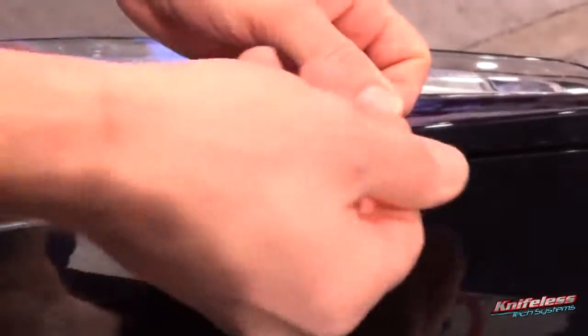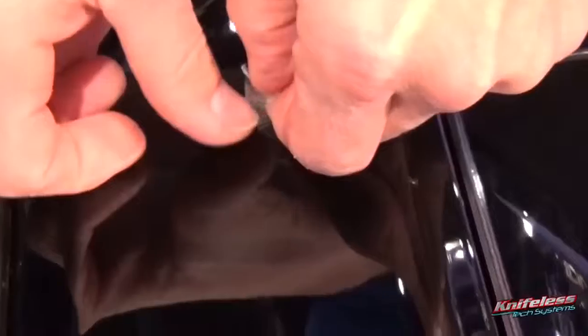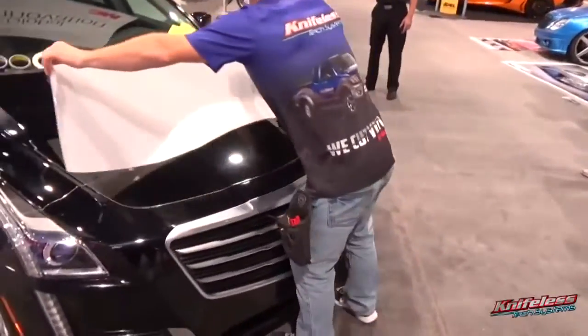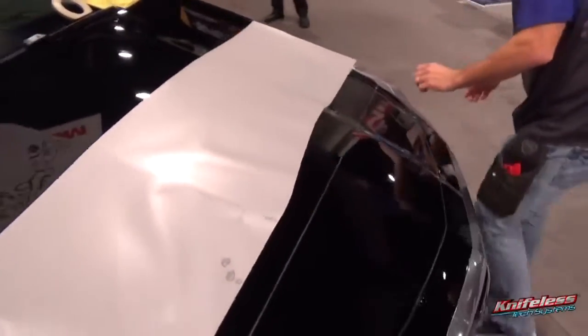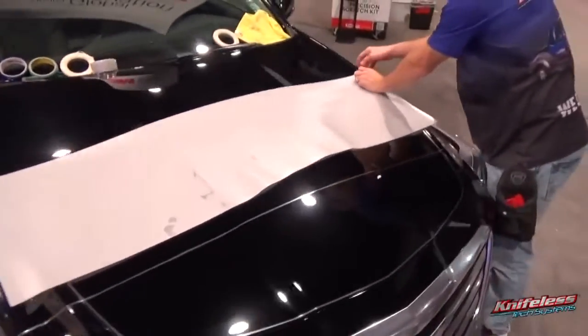So you just want to release the wire and keep the tape on, and then just hold it onto the surface. Notice how he's keeping the tape on and locks it in position there. This had 4 edges. You want to make sure you release all 4 edges and then tack it on. Once that is good to go, and you know you can pull the wire easily and safely on all 4 edges, you want to apply the PPF film in its standard procedures.